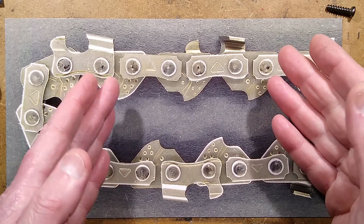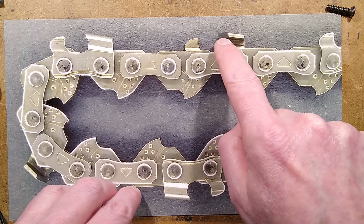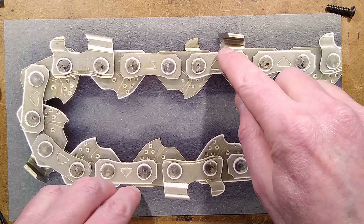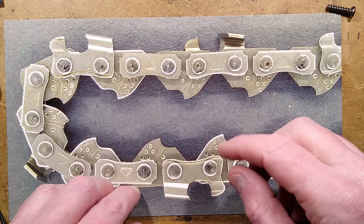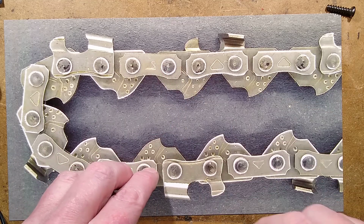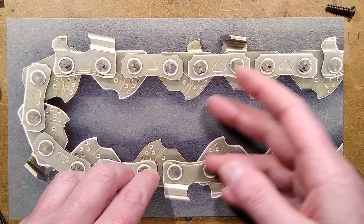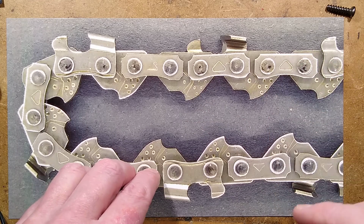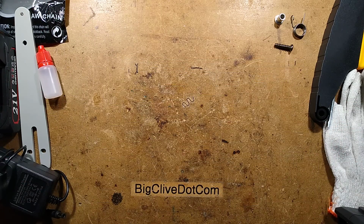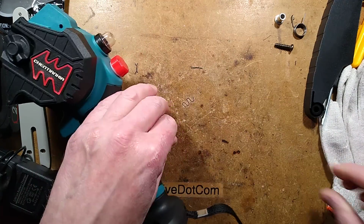And the way it should actually ride in the chain is that the cutting edge, the sharp edge, you can feel it when you run your finger across it, should actually be going in there. And you can sharpen these chains. You get tools specifically for it, or you can use a file if you're skilled. But you get various guides and little tools that basically have little reamers that wind in and give a perfect edge. Project Farm featured some sharpeners. I mention Project Farm again because he's been featuring so many things that are relevant to the recent videos. Right, tell you what, let's zoom back out now that you've seen the anatomy of a chain, and we shall take a look at, well, the gloves.